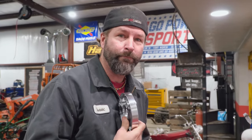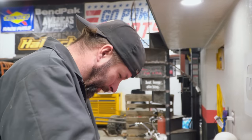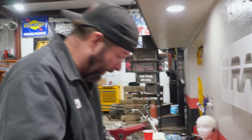We learned something else too. You should probably put the rims together before the tires and tubes, and put them on your project to make sure they fit. Apparently, with the 1-inch spacers, we don't have enough spindle. So Charles just figured that out. So I'm going to be installing the two halves without the optional spacer, because it doesn't fit.